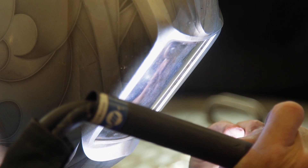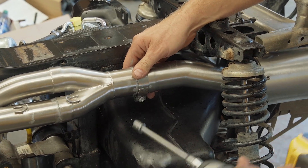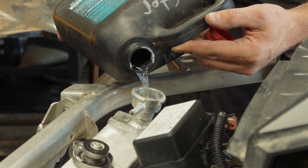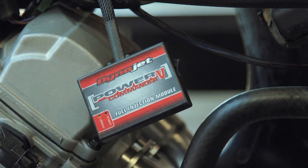I was really excited to see what we were going to get on the dyno. Factory on all these 800s is around 50 to 52 horsepower to the tire, which is pretty common on about any dyno, and these will make between 75 and 80. That's with Mr. RPM Maverick-style OEM heads — not but $250 a pair — Mr. RPM cams, stock 800R intake, bored throttle body, HMF full exhaust, and of course a power commander and a reflash to tune with.